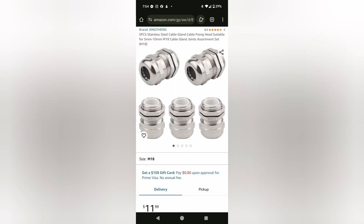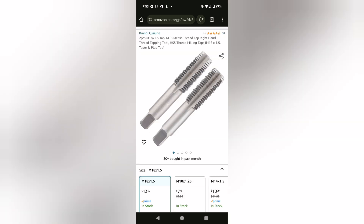This is the cable gland that I used, since I was unable to use the factory pass-through due to clearance issues between the housing and the ring gear — it had put the wires too close to the bolts and might have rubbed through them. So I utilized an aftermarket cable gland, bought a tap for it, drilled and tapped the hole, and sealed it all up.